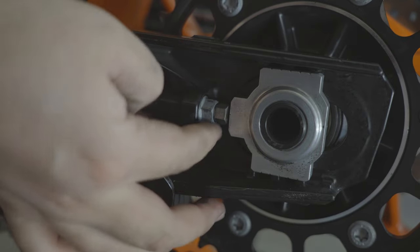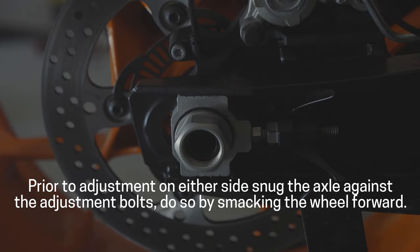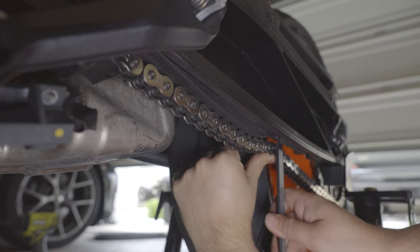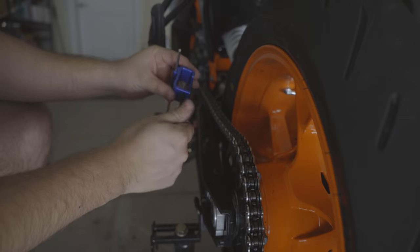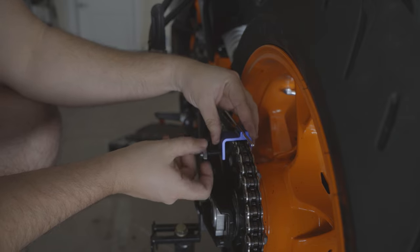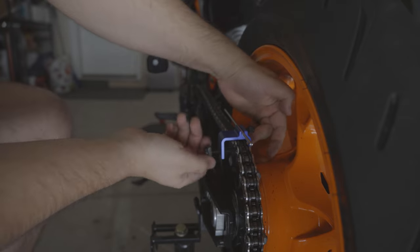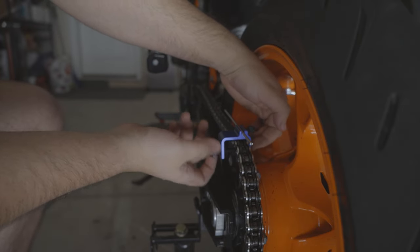From there, you're going to want to go chain side and really dial in that measurement. Once you've done that, make sure that you've snugged down that locking nut so it doesn't move too much on that left side. You're then going to use your chain alignment tool. This is low tech — some people use a laser that shoots down the center of the chain, which is preferable; I just don't have one yet. Using this pin, you're going to want to make sure that it's parallel with the chain as it travels down.